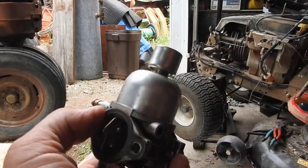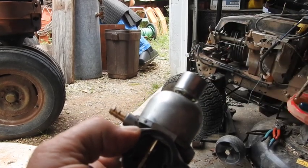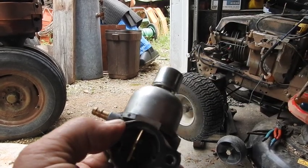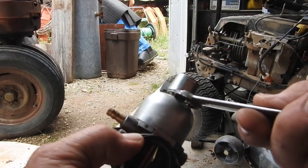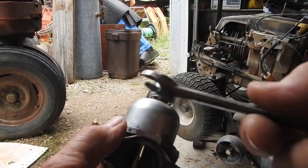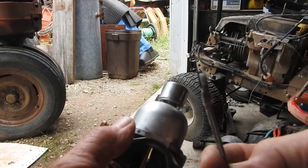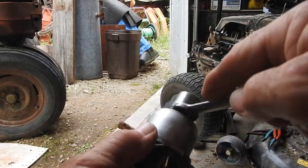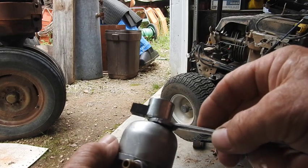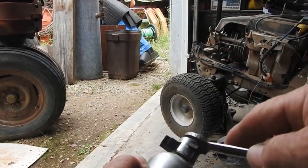I probably need to tell you — the space you have to get in here is so thin that even the thin wrenches in your toolbox won't get in there. So what you have to do is take an old scrap wrench — this happens to be a half-inch on most of these — and go to the bench grinder and grind it down on both sides so it will fit right in underneath there.